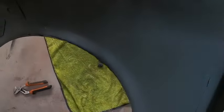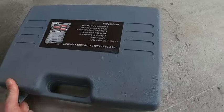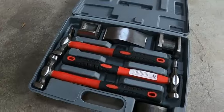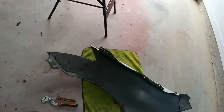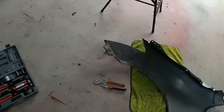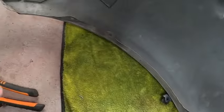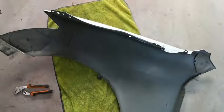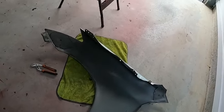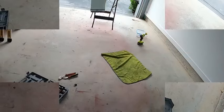The good thing is because I've already got the fender out I can just use a hammer and dolly and dolly it out - just hammer this area and that flattens it. Hopefully by the end of this episode we should have it painted - wishful thinking, I know it's not gonna happen. Anyway, hammer it down. Even this one - you see how it's just bent - I'm gonna use the hammer and dolly and fix it up. Ideally I prefer not to use body filler but if I have to then I'll do it.